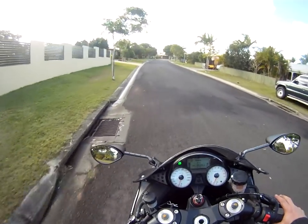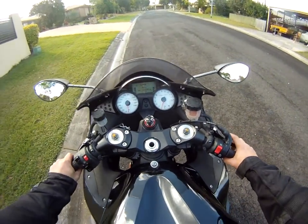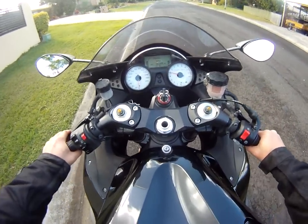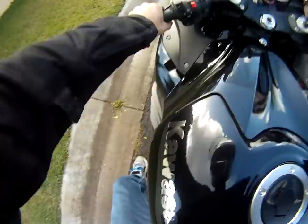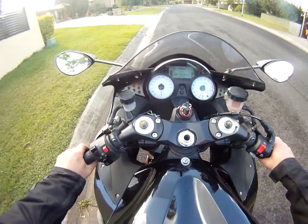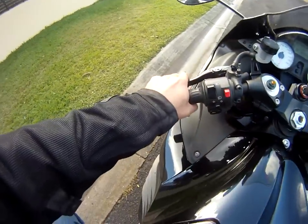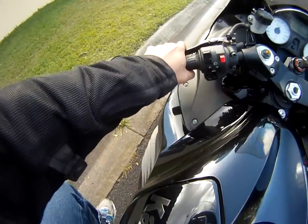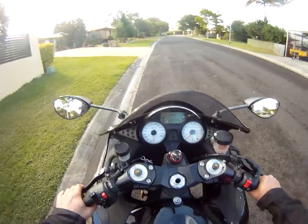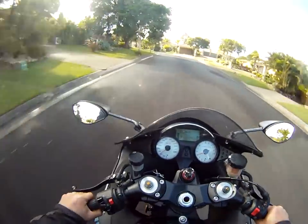Let's go up to a high gear and go through that procedure to get back into first gear. Here I am — I've stopped at a set of lights or a stop sign and I'm in sixth gear. Push down on the lever — that's five. Let the clutch out slightly, push down — that's four. Let the clutch out a little, push down — that's three. Let the clutch out a little, push down — that's second. Let the clutch out a little, push down — that's first. If you simply sit there stamping on the lever it might change once, but most likely what you'll do is bend the selector forks.